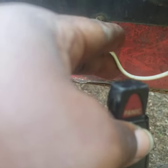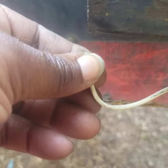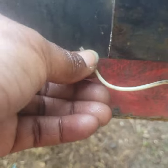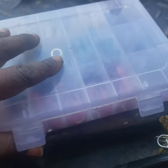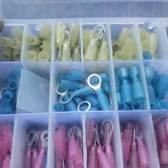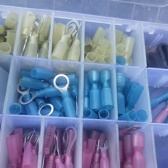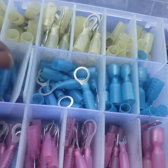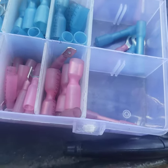All that needs to be done is take this bolt out here. You can see the pieces here are broken — it goes over that bolt. So you can order a pack of these ring terminals from Amazon or eBay if anybody ever has a trailer and has this issue — just choose the correct size for your wire.